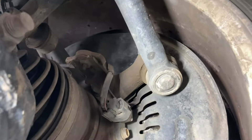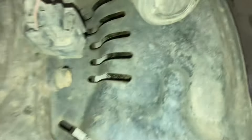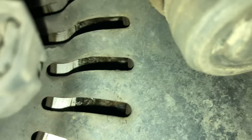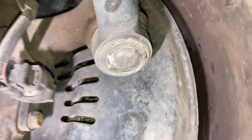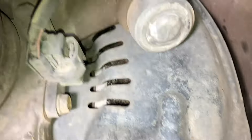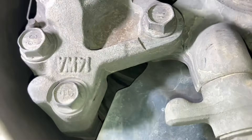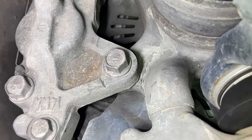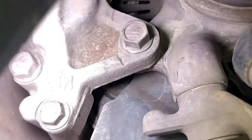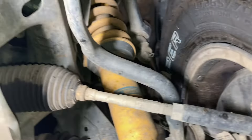It's got Bilstein, so good luck. What's going on with these rotors? They look a bit weird - all black and strange. They're slotted. They've been machined, and that's the problem with slotted rotors. See how the slots have pushed through onto this side when they've machined them? Long story short, you don't need slotted rotors, and it's a waste of money.